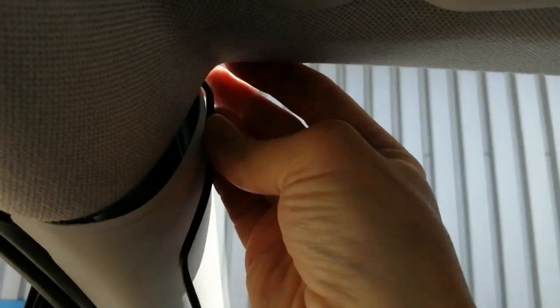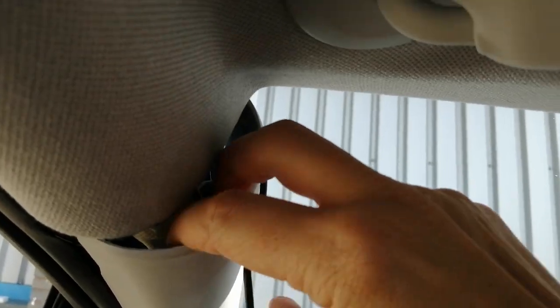There's this plastic trim. Now you're going to need your plastic leverage tool to pop behind it, and there we go, click. It comes out, as you can see, enough to go behind this. Now in there's an airbag. You can see the airbag just there, look, there it is. We're going to tuck the cable behind the airbag and go down with it.